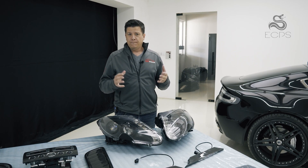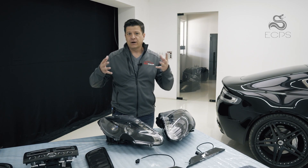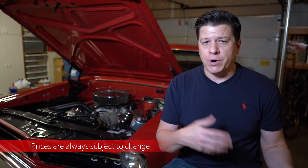This is a very difficult thing to do, but it is possible. Just be careful because it's easy to damage the lenses, and you cannot buy these components separately — you have to buy entire headlight assemblies if you want new ones. Having the headlight apart and clean makes it look easy, but getting it disassembled and cleaned with all that sealant removed is actually quite difficult — a lot of time and elbow grease. It may be worth it because headlights are very expensive. The last time I checked, retail was somewhere between $2,500 to $3,000 for a single headlight, so for many people it's worth giving it a shot.